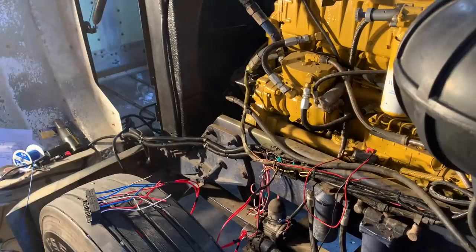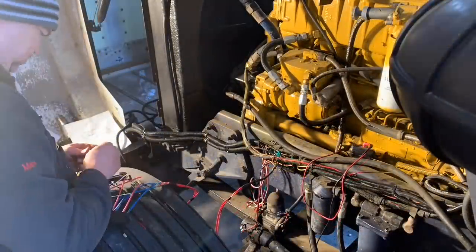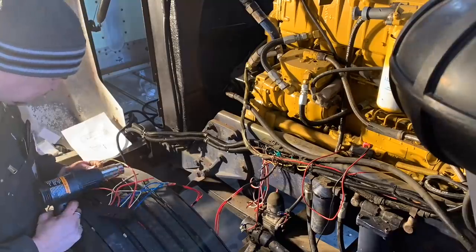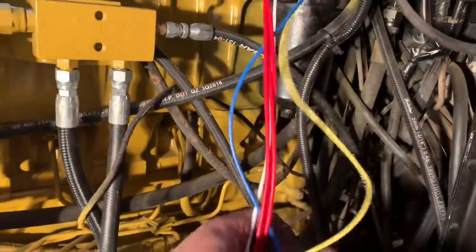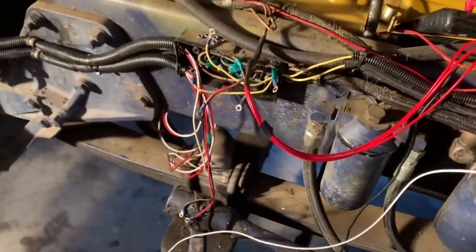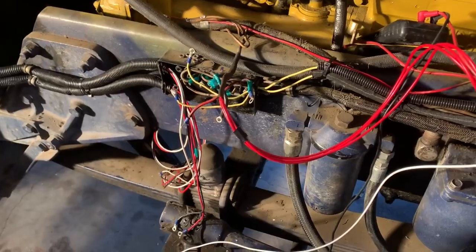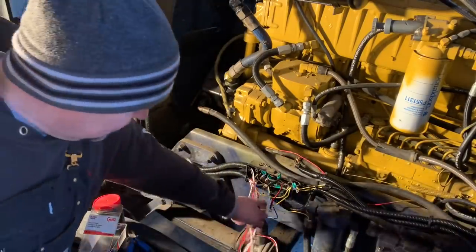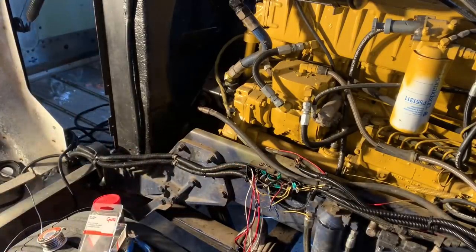Now I need to run wire from the relay on the hot side - one down for the low beams and one for the high beams. We'll probably use the third relay for the load lights to wire up later. Pretty straightforward stuff, just time consuming. Days slipping away from me - I've been working on lights for three Saturdays in a row. Hopefully get it done today. It's now screwed snug to the firewall. I'll solder little rings on the ends and terminate them at the correct stud - maybe we'll get lights, you never know. Got it all loomed and zip tied and brought into the junction box.